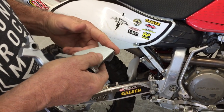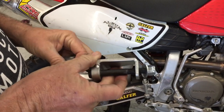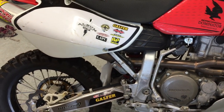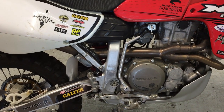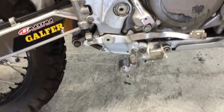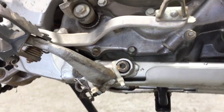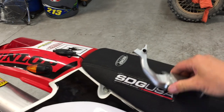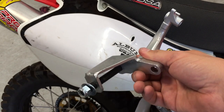The rear one still goes into the aluminum, but the front one goes on the other side of the frame and just pulls everything together. Back in 2000, were you getting bikes in the shop with this problem? It was a very common problem for 650s. It started coming in — we didn't really do the system Honda was doing, because they were having their machining department machine everything flat again. It was a lot of work, and we looked for a stronger but also more simple way of doing it — one that people could install themselves. As long as you have a drill bit and can drill out the front hole, you're good to go.